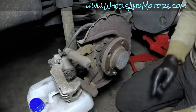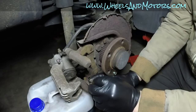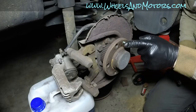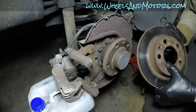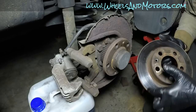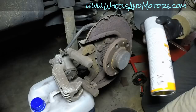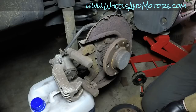The small springs should come with your new brake pad set - they prevent the brake pads from rattling. Fit them in their correct locations. Now fit the disc back on. Try not to leave any greasy fingerprints on the disc surface. New brake discs often come coated in oil to prevent rust in storage - clean this off using brake and clutch cleaner spray, then wipe with a clean cloth or kitchen towel.